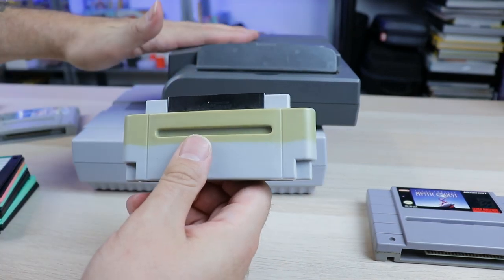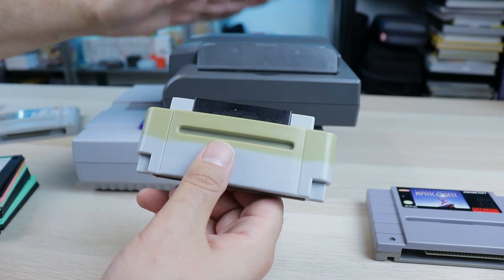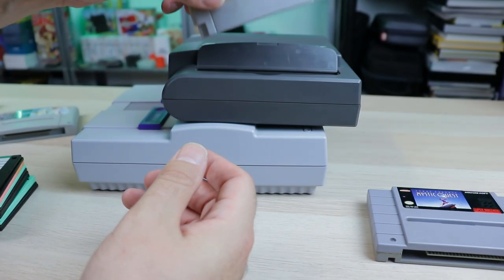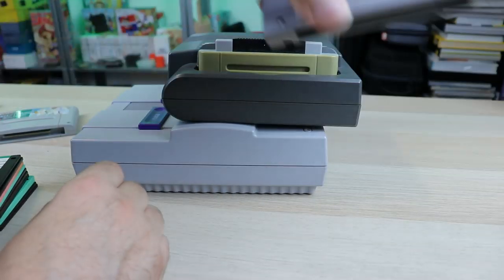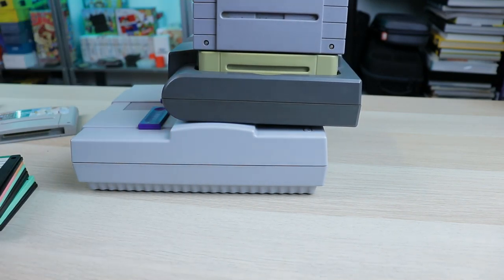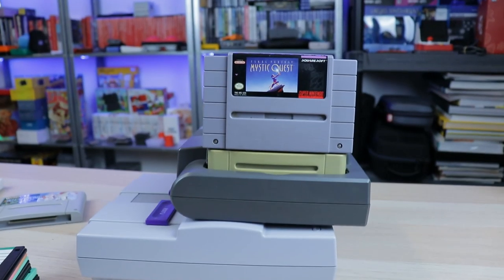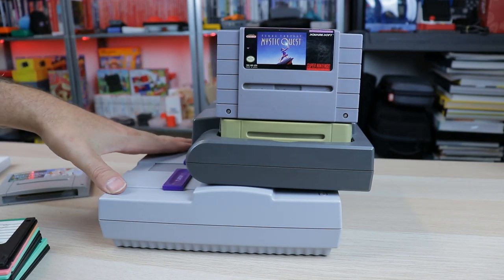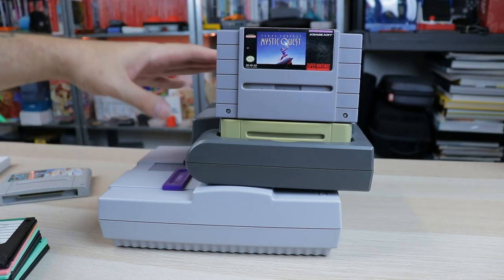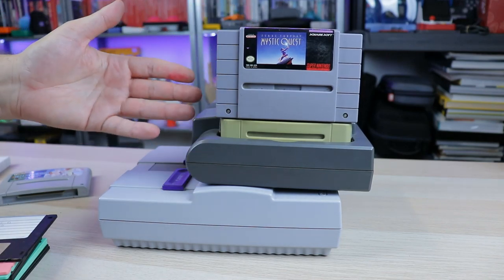But it does work with this adapter that came bundled with this. From what I've heard, these Super Disk Interceptors did come with these. This could either be used on this unit to plug it into a console. From what I've tested, it works in Super Famicom and a US release system. I'm assuming this was probably more so for this section — if you had your system modified with the lockout chip bypassed, then you wouldn't have to do this. In order to use it on a US system and load a floppy disk game, you'd have to have it set up like this.